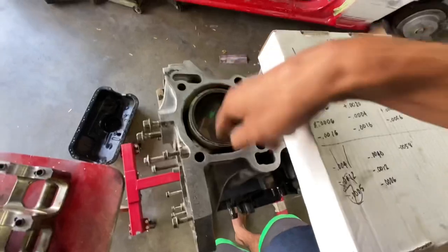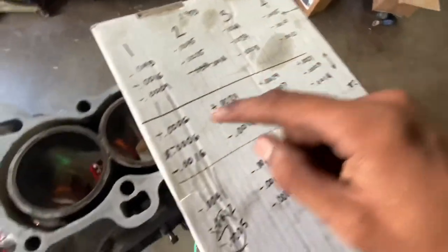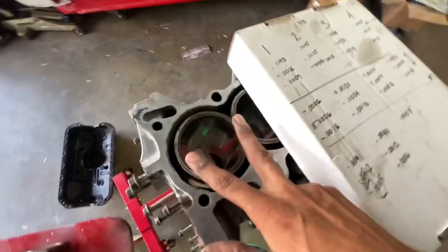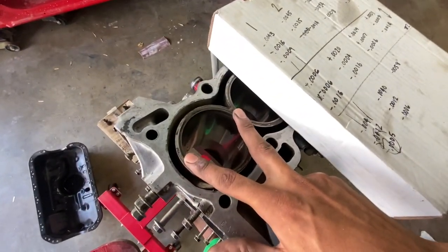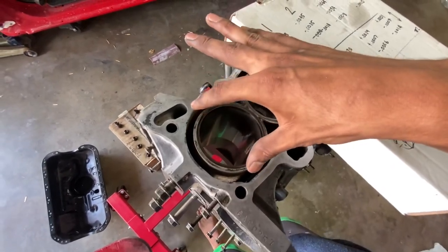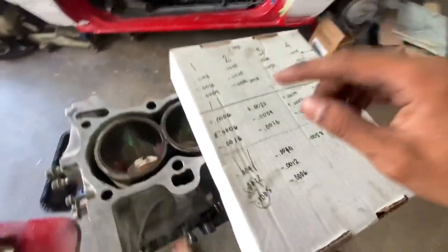The second column is our front-to-back clearance, and we are 0.0006 above 75 millimeters. So we can tell the top of our cylinder wall kind of shrunk and then stretched — it's kind of an oval shape. Not an extreme oval — 0.0006 of an inch is very, very minimal.